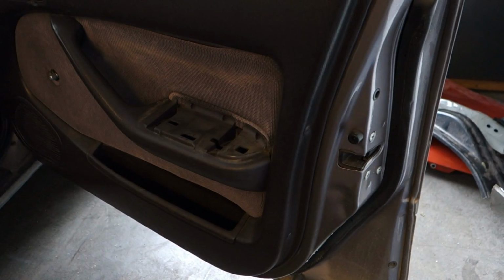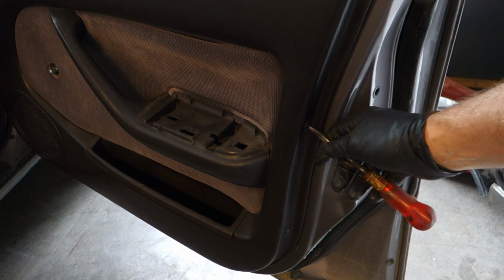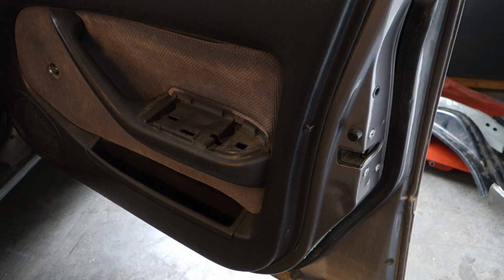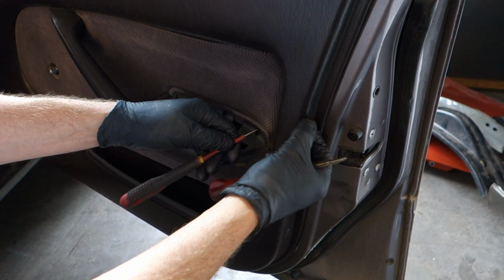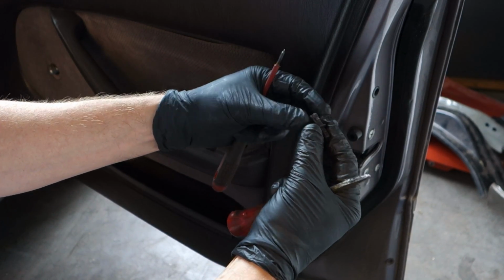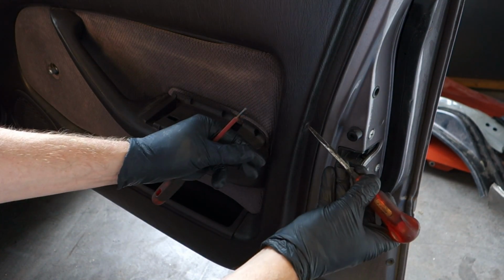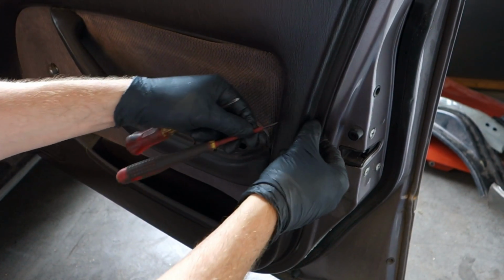And there we have a small plastic specific fastener, and we need a tool with a sharp spike. When I insert my tool in here and press it in, this thing opens, and then I pull out this fastener. And if we have a flat screw head, it is easier. This is like a locking pin, and now it's in the locking position, and we need to lower it that way. Then when I insert it back in here, now it's open, and when I press that, now it's locked. When I take it out, I first press it in, and then with a flat screw head I take it carefully out.